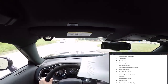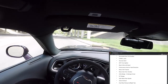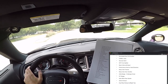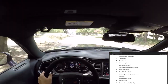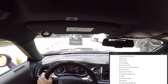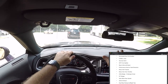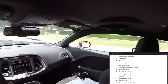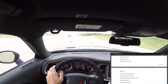SRT front splitter, black grille with bezel — the 2015-and-up got the '71 Challenger-style front grille. Performance hood with heat extractors, which used to be the Hellcat hood and is now on Scat Packs. Body color fascias, body color door handles, body color grille badge, Challenger script, RT badge on the grille. Satin black rear spoiler — just the standard regular spoiler. Active exhaust: there's a butterfly valve in each exhaust pipe that opens fully for wide-open driving and closes to restrict to a small opening when cruising.